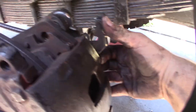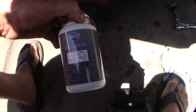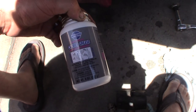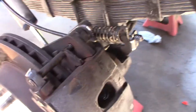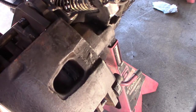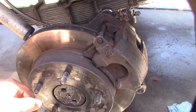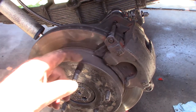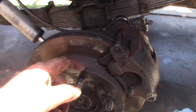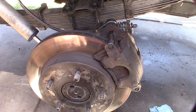I want it to lock up right away. I'm going to grease up my pins with this synthetic caliper grease — I do that every time I do brake work. I'm going to put this thing back together, then do the other side — same procedure — and come back for a test. I can already tell these are way tighter. It might take driving around the block a couple times to heat up the rotors and wear out some of this material on the brake pads — I'm willing to sacrifice a little material to make this work right.